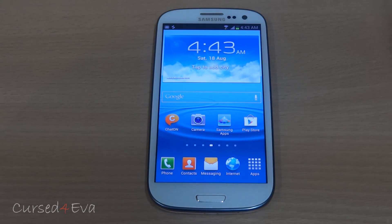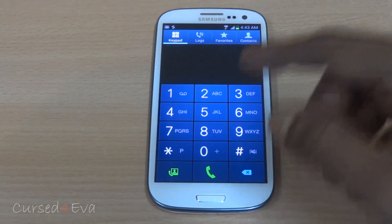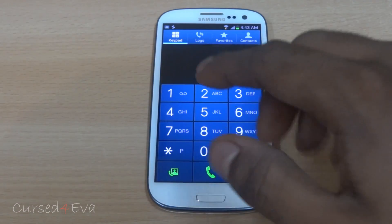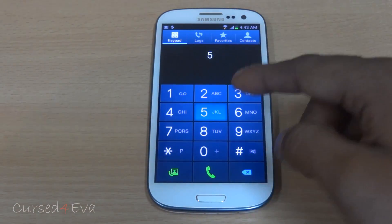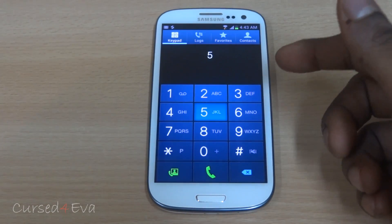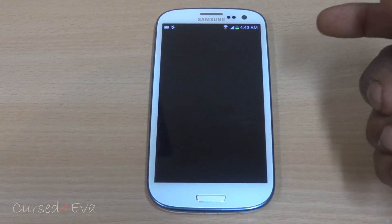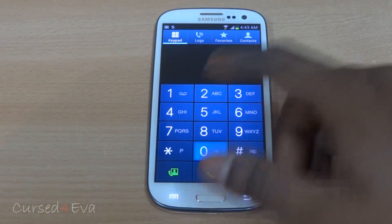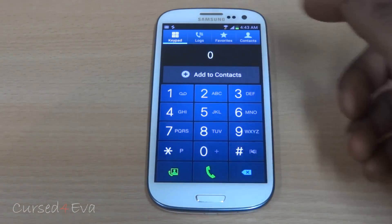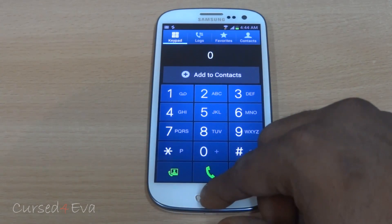There is one important glitch here. Going into the dialer, you will not be able to hit any key apart from 0. The smart dial feature does not work because of this. If you hit 5, you're going to get a 'contacts has closed' error. The only way to make calls is to hit 0 and then dial a number, or go into contacts and call someone from there.